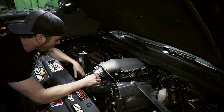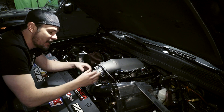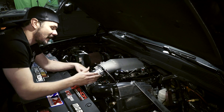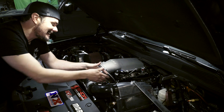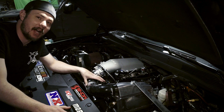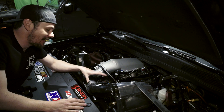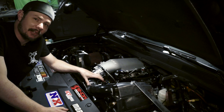We do have a lot of straight sections, and the important part about that is it creates laminar flow. The longer the section is, the more time the air has to smooth out and go across the hot wire sensor in an orderly fashion, which allows it to calculate properly — because it is based off of your intake tubing diameter. Once we get this dialed in, technically even the previously calibrated one should read correctly since it's on a three-inch pipe. Only changing the diameter of the pipe is going to change the amount of air. We would hit new sections of the mass airflow sensor by going into higher boost, but up until the boost point we saw previously, this thing should have been pretty accurate. It is not.